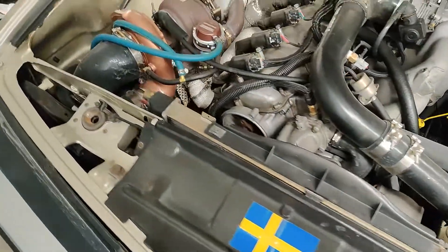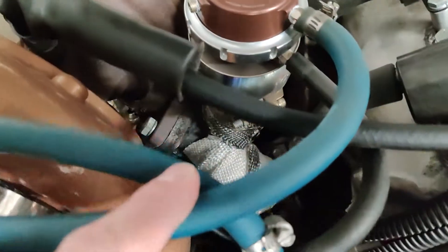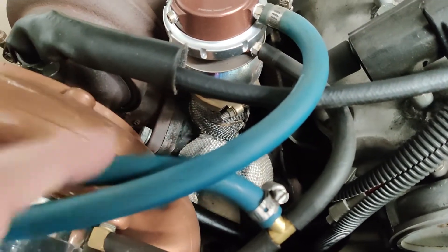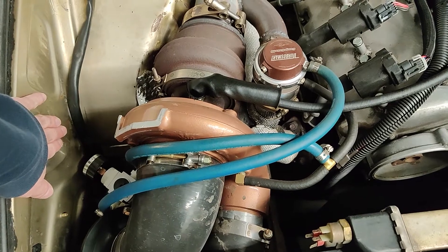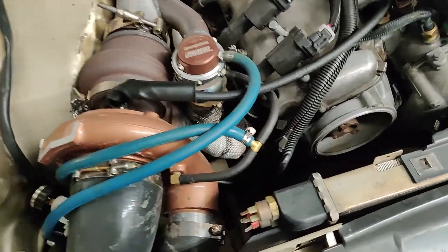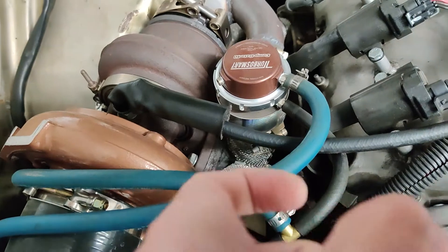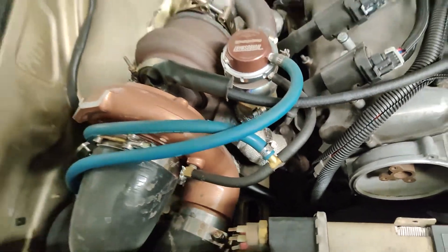Here's the car — my trusty old M30 on the E28. It's a little tight in here, but there's actually pretty good access to the turbo manifold. Right there is where it bolts together, and where you see my finger there's a nice little spot where it all merges. I'm going to drill and tap right there, then come out and mount the pressure sensor either on the side of the engine bay or vertically with a P-clip on the fender. Right before the turbo is the best spot — I can move these hoses around and get a drill in there.